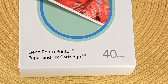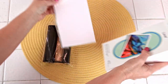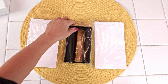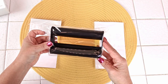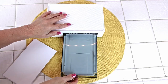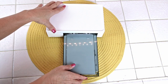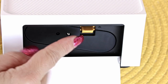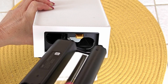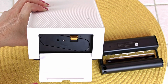Here's what the replacement paper and ink cartridge look like — when you open the box it comes all packaged and wrapped up. You've got your cartridge and two sets of photo papers, 20 in each, sealed in plastic for freshness and protection. Replace the photo paper into its cartridge and put it back in the machine. Open the side panel, press the yellow button to pop out the old ink cartridge, pull it out, put in the new one, and it snaps right back in. You're ready to go.